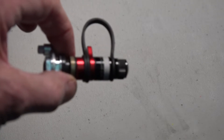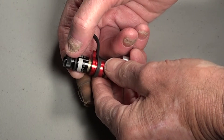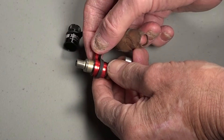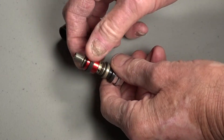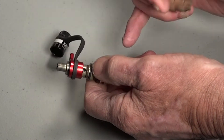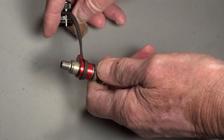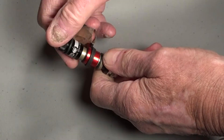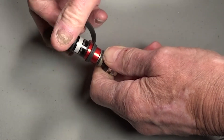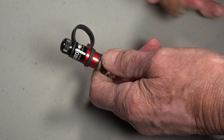When you install the valve it goes through the existing valve stem hole. The Apex deflator has its own valve cap and you want to use that because it keeps the valve locked into place. The valve slides up to release air — you can see the holes and ports here. Push down to close it, and when you screw the cap back on, that actually locks the valve in place so it can't get bumped out on the trail and cause a rapid loss of air.